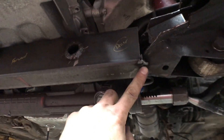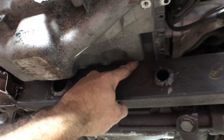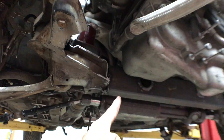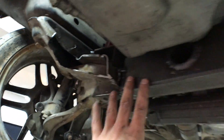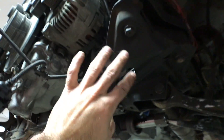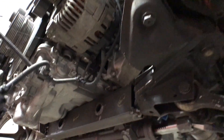This section was cut up and a new one welded in right here. It's only tacked for now, but there is a little bit of clearance between the oil pan and the subframe — we need to make sure there is enough clearance. There will be more welding, more gusseting, tons more welding in order to get this front subframe completely integrated into its mounting locations along the frame rail.